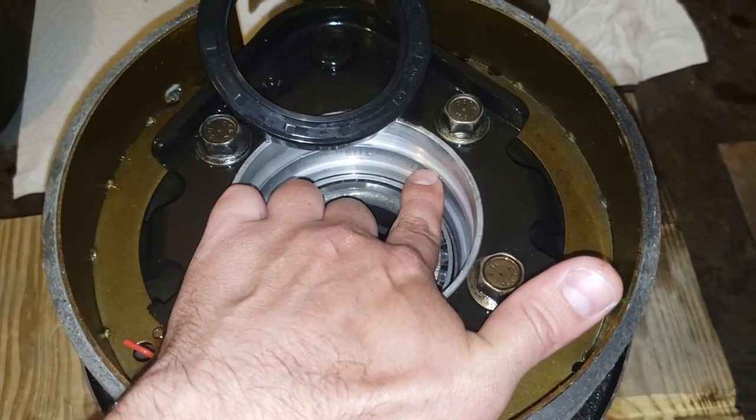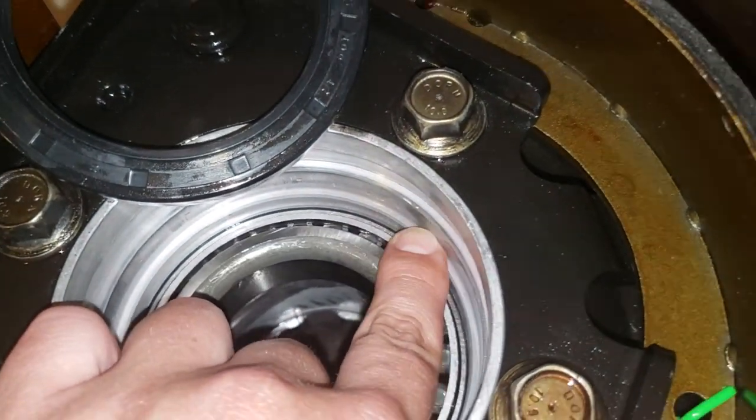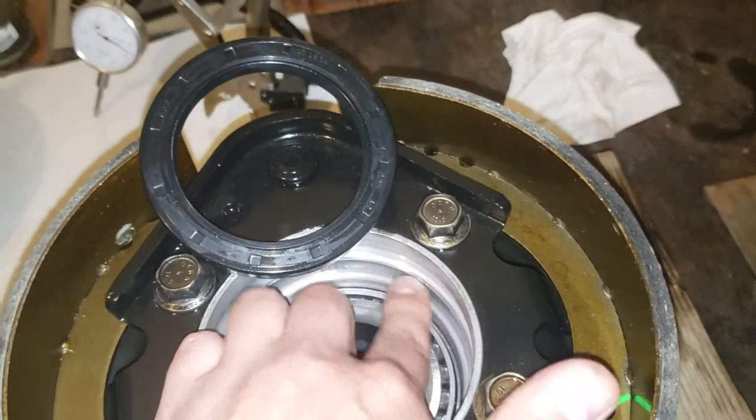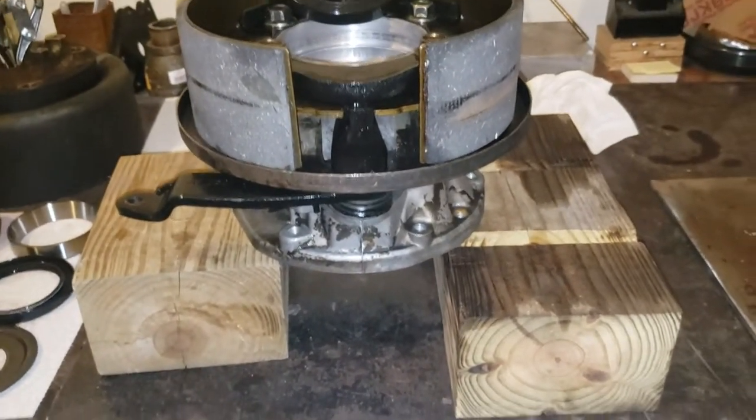It's not tight on this upper surface — it'll slide right past that. You've got a deeper groove in there, and the seal wants to seat right in there, which is right off the bearing where it's supposed to be. If you drive that all the way in, your bearing is just going to sit in there — prop this up on a couple pieces.